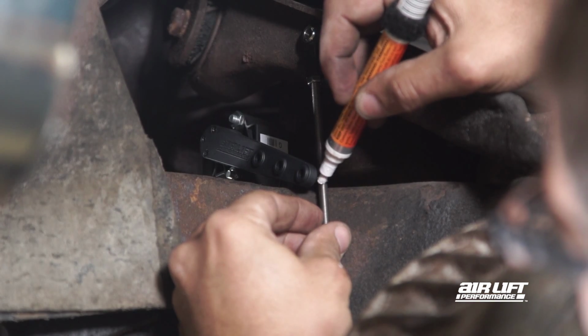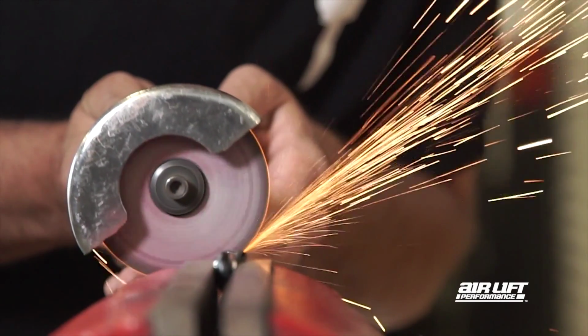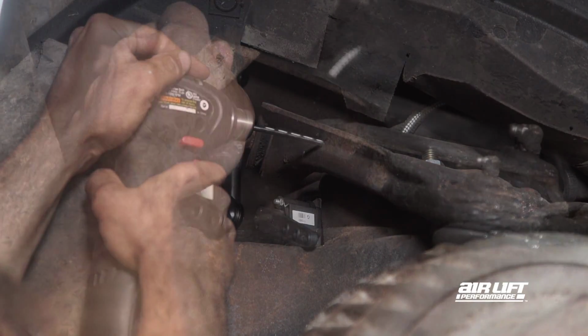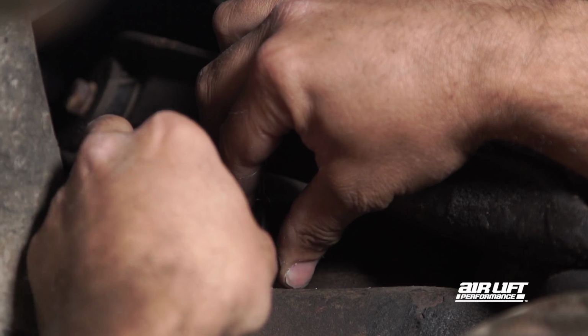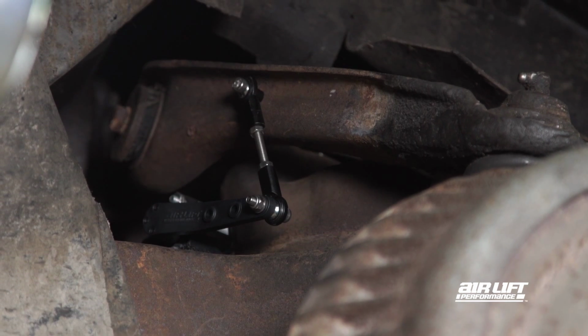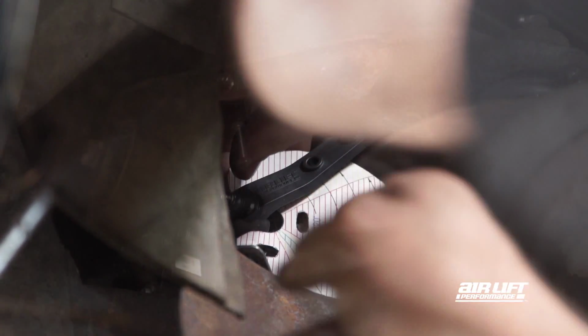With the lower arm mounting point determined, you may shorten the rod if needed. Make sure the sensor arm and linkage rod avoid binding and obstructions. After you have attached the linkage rod at the correct angle, cycle the suspension and double-check that suspension travel is within range according to the supplied template from the manual.